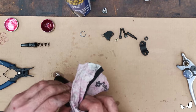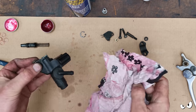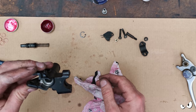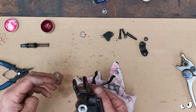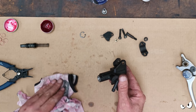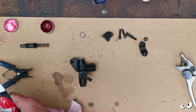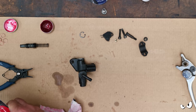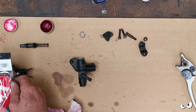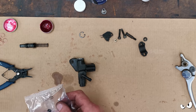Right, it's all nice and clean. I shoved it through the ultrasonic for just about five minutes and then some brake and clutch cleaner just down the bore. That's all nice. The paintwork is a bit bleh but I don't really care - it's all going to get done when it gets built. Right now all I want is an operational master cylinder that's safe and works. Another pot of red rubber grease, and this is a service kit - eBay special.